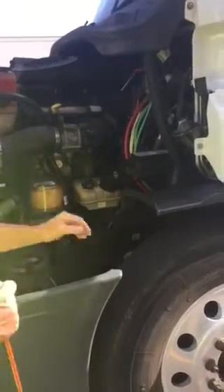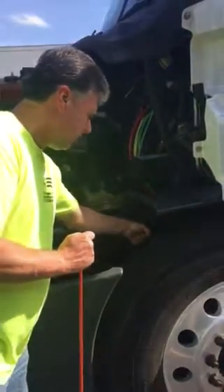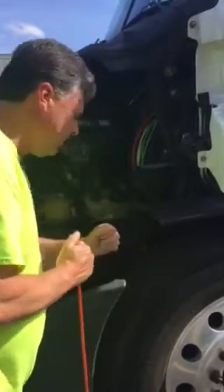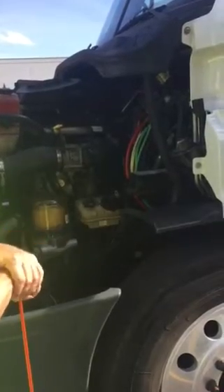Now I'm going to move into my braking system. My brake hose is not cut, cracked, dry rot, or bulging, and I hear no leaks. My brake chamber is not bent, cracked, or broken, missing nuts, bolts, or screws, and I hear no leaks. My slack adjuster, push rod, and cotter pin are not bent, cracked, or broken, missing nuts, bolts, or screws. They sit at a 90-degree angle, and with the brakes released, I shouldn't be able to move them more than one inch.